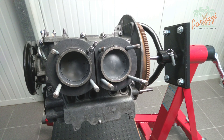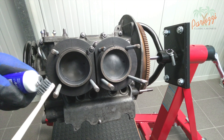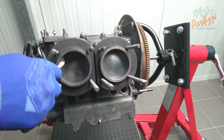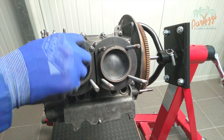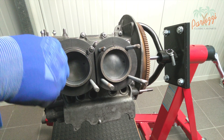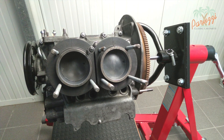If the engine has not run for a long time, the cylinders have probably dried up. With the piston at its bottom dead center, smear a little assembly grease against the wall of the cylinders. You may also use engine oil, but unlike assembly grease it will disappear quickly.